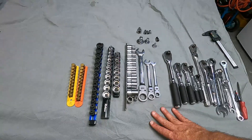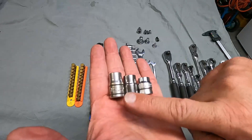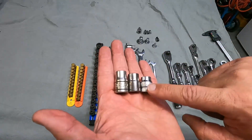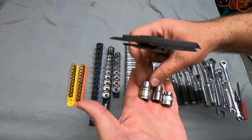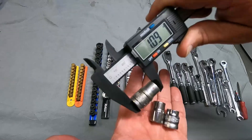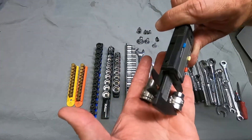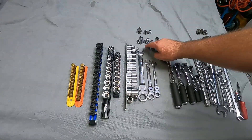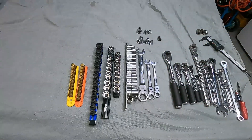Sometimes it's really hard to get to whatever part you're working on. That's one of the reasons I've always purchased different socket sets over the years — you can get different heights with each one. For example, this Allied socket is 1.09 inches, this Craftsman is 0.93 inches, and this Koken low-profile is 0.78 inches. It's really hard to beat the Astro Tools with their dual drive — the hex drive on the outside where you can use a 17mm box and ratcheting wrench. That's where these GearWrench, LA Bear, and Tone adapters will come in handy, although not so much the quarter-inch size.